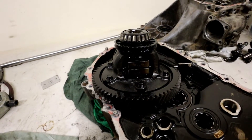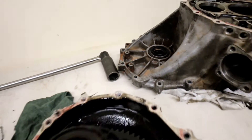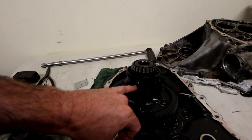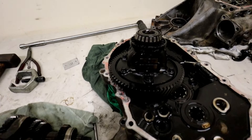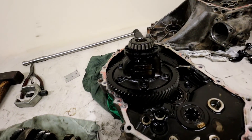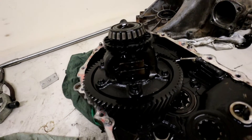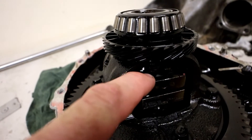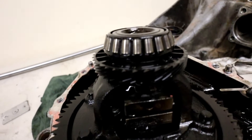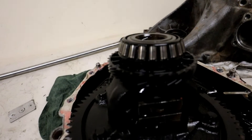It was leaking pretty much straight away as soon as I assembled this gearbox — leaking out of the drive shaft seal. I didn't bother changing it because, due to the noises it was making rattling at idle and just the nature of it being $35, I really didn't think it was going to last long, so I didn't bother checking the oil level. But 12 months later and almost 10,000 ks, the gearbox is still working fine but just dropping out of fifth gear. If we have a look in there — you probably can't see it with the camera — in between the spider gear and the LSD plate it is worn quite heavily. So we need to go ahead, put the grenade pins back in, pull this centre out and have a look.